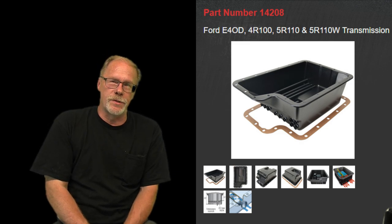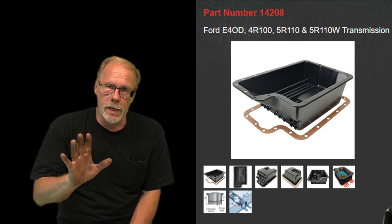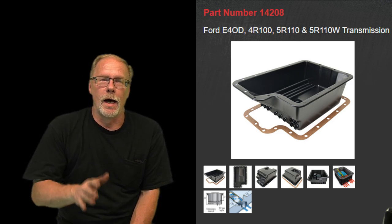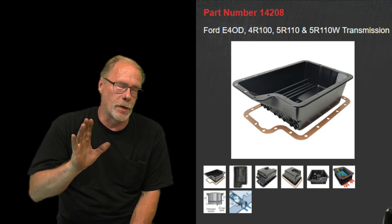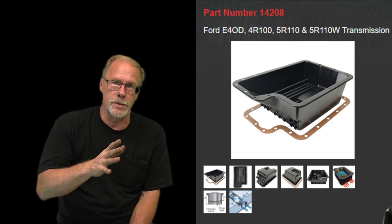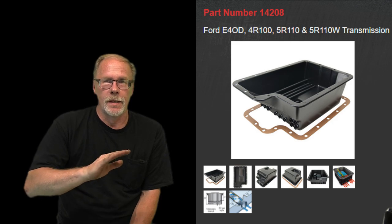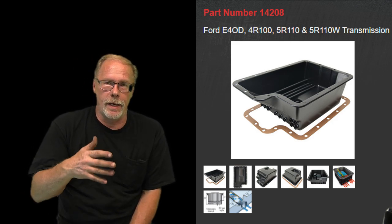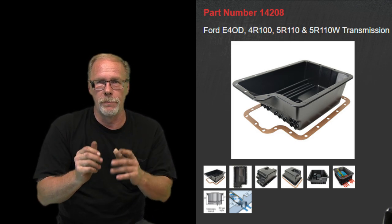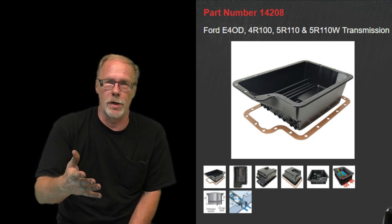There you have it from Dorelli itself. Down in the description is their website if you want to order. The same thing — a whole bunch of companies make these pans and they're all high quality. This is beneficial no matter which company you go with. It adds anywhere from five to seven more quarts of capacity depending on the company, and the more fluid you have, the less chance of overheating — simple as that. The pan and that 6.0L cooler can be used in combination, or you can just choose one. They're both easy to install.